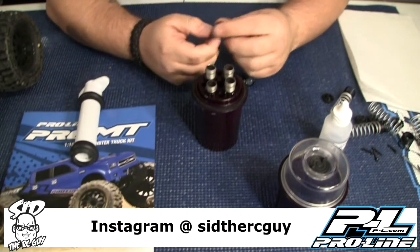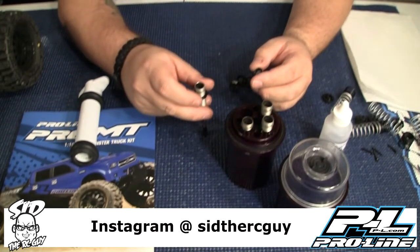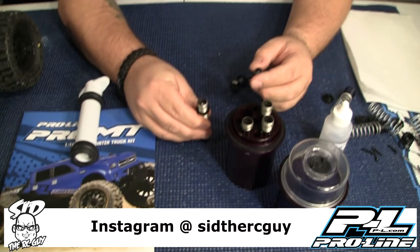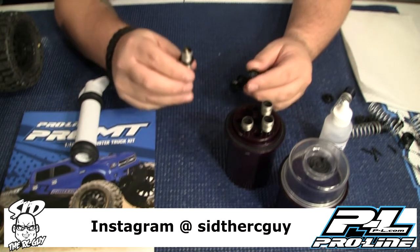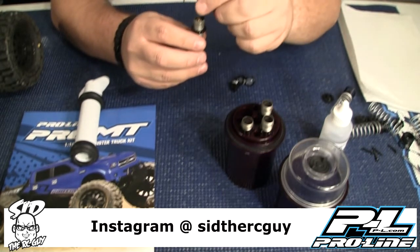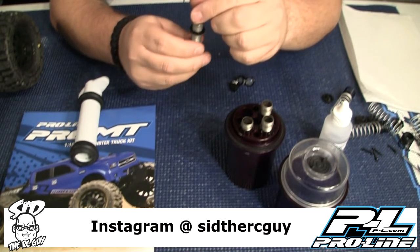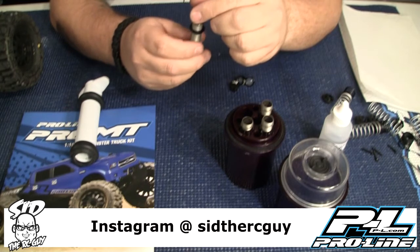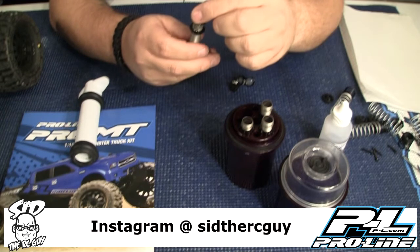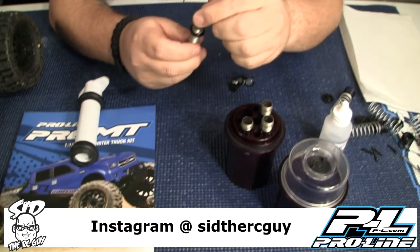What I'm going to show you is how we put these on, because you will have to bleed them, burp them kind of deal. So you'll push the shock all the way up. Like I said, you're going to have some excess oil that as soon as you put it on is going to spill out, so don't worry here. Go ahead and push this on. Then usually I let go of the bottom just a smidge while finishing off, because there is a little bleeder cap on the side that's going to help with the breathing part. And then you just screw them all the way down.